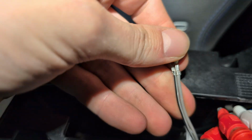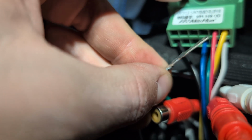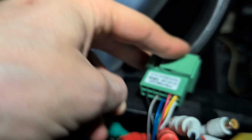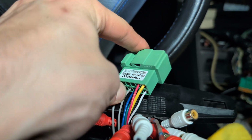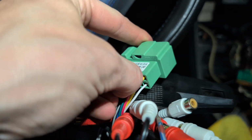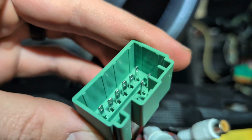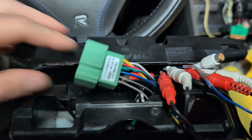All right, so we can go ahead and get rid of this connector basically completely. And then we're going to add these wires to the green plug. Gray with black is here, and our little connecting pin goes up. Slide that in, and that's in place. Now we'll do this one as well. And you'll just hear it click. There it is. All right. So now this has been repinned. We can reinstall the plugs and test the center channel out. I'll show you that in a moment.